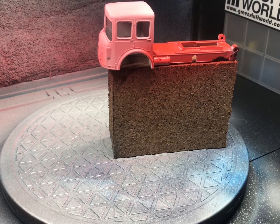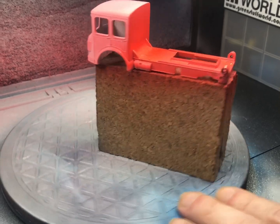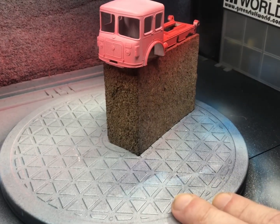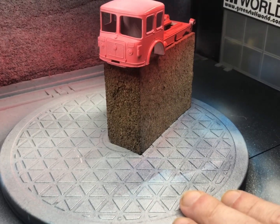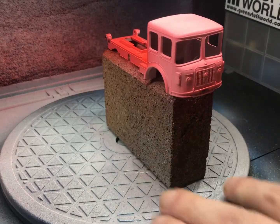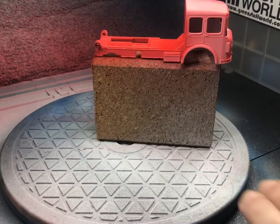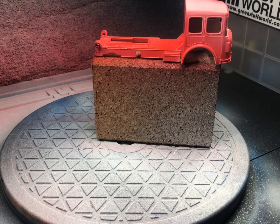So I started to spray it there around 20 to 24 psi, and that seems to be working out well. So I'm going to stick with that for now. See how we get on. And as you can see, we're getting some really nice coverage and it's going on nice. So if it's not broken, as they say, don't fix it. It's a bit ironic for a restoration video.